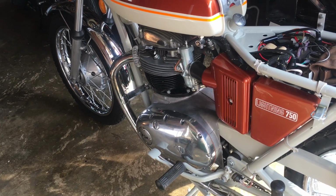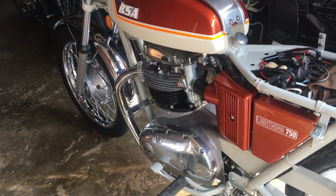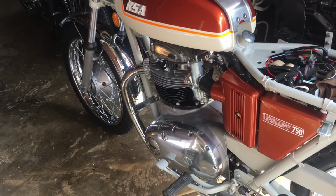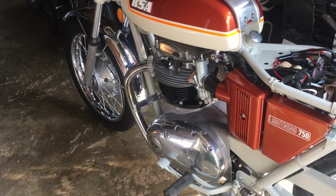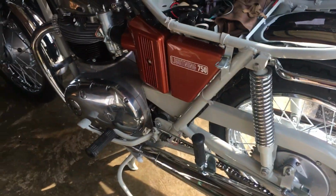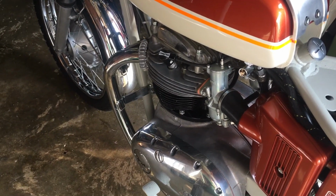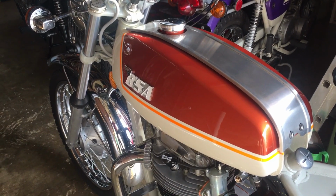When I revved the motor slightly, it was a bit tappety on the right hand side, but now she's settled in anyway, we'll lift the rocker cover and we'll see if we can get another eighth of a turn on the head nuts, and then we'll reset the tappets. But other than that, really pleased. Ever so smooth, but then the crank has been dynamically balanced to get against the rods and the pistons that are in it. So dead chuffed.